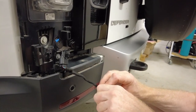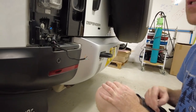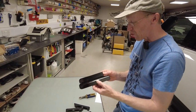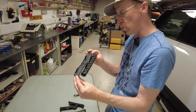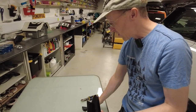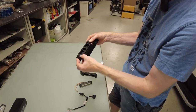The two little pins - there's a location pin and a keying pin - locate the connector so it doesn't wrap around. We've got enough room to tuck that back down in there. Be careful: don't go trying your lights or unlocking your car with these exposed because you will blow a fuse. You need to make your connection from these wires to the new lights, and get it all together in the right order. We are working on the left side of the car, so we need the one marked 'L'.